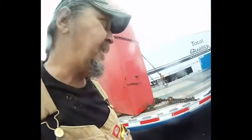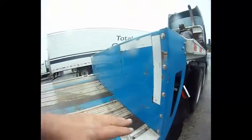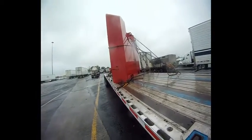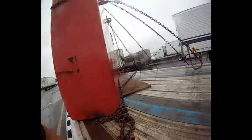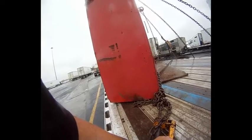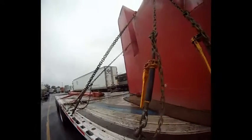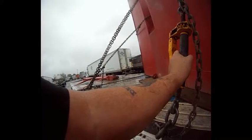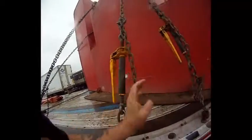I got pretty filthy out here — it's raining and you get muddy. If you look at my sidewalls, they're not bulged too bad, and even though I'm tipping downhill that sets the weight slightly forward. You've got to take that into account if you're looking at your tires and thinking something looks off. You'll get to know it after a while. This is supposed to be a 42,000-pound load — scale the sucker. Don't take a chance unless you've got your own scales aboard that you trust.